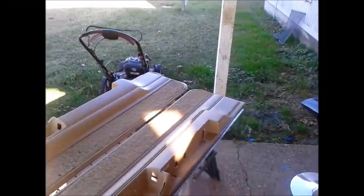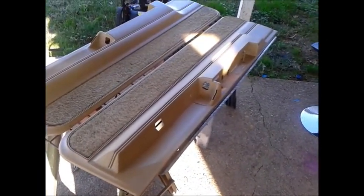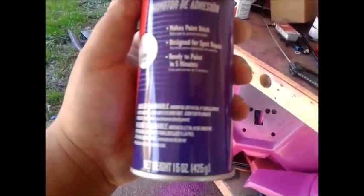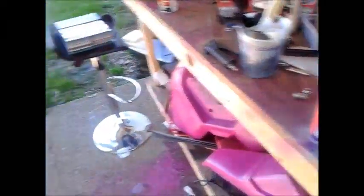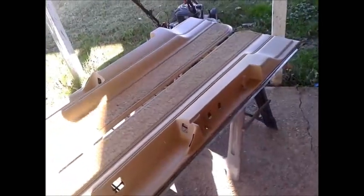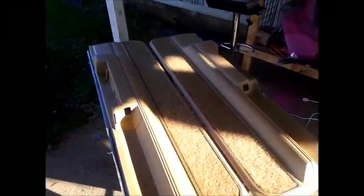You know — matte paint, fleece. Pretty sure you guys have looked up how to do fiberglass. Well anyway, this gives it the same look. But in order to make paint actually stick to plastic, you need to get this stuff right here — Bulldog Adhesive Promoter. It makes paint stick. It's ready to paint in 5 minutes and it works on plastic. So if you're painting four-wheelers, door panels, anything plastic, spray that down first, sand it, prep it, then spray that right before you do the paint. I know I've sprayed one coat on it — I'm actually gonna go ahead and hit another coat, then I'll be ready to spray some purple on it.